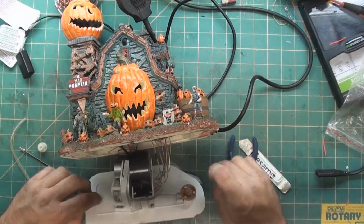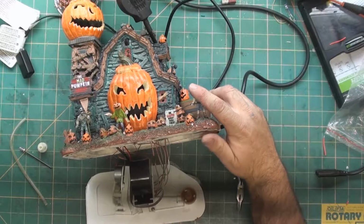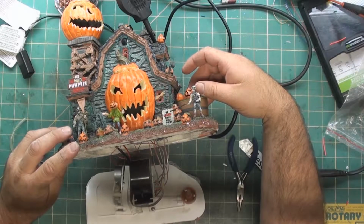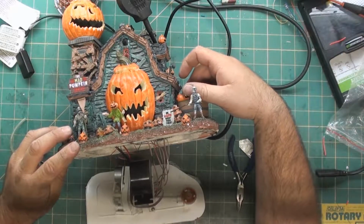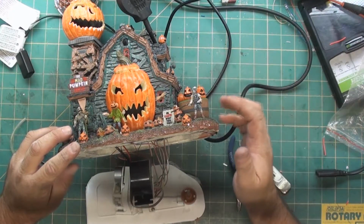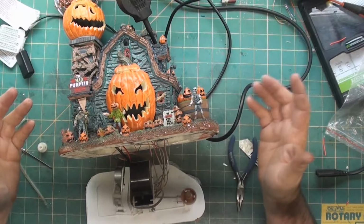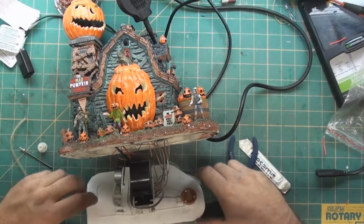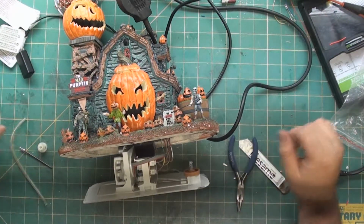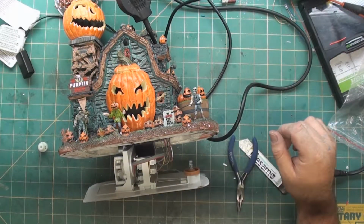And that is most likely what's causing the barrel to occasionally jerk, because this barrel is absolutely smooth. It doesn't have that little hitch in it like the last one. It has some lateral movement, so the hole that they bored into this housing is a little bit bigger than the last one, but there's no plastic piece hanging inside. I think it's just catching the base. So of course we're going to trim that before we reassemble it. So right now we're going to stop until I can find something to replace this broken drive shaft.